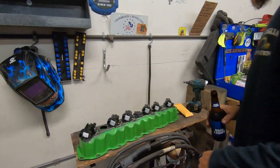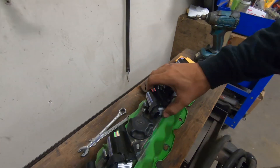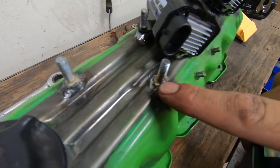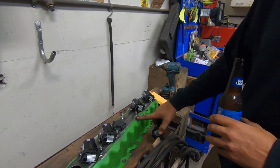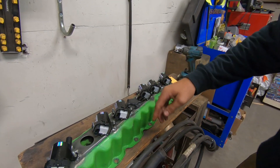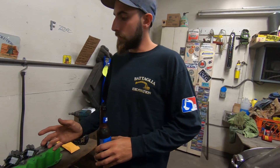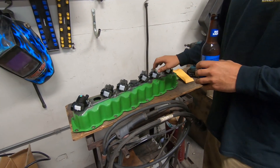While Jeff's working on the wiring, I decided we need to mount some coil packs. What I did was go to the trusty dusty hardware store, got myself a couple of bolts, and welded them right to the valve cover — because to me that's the quickest solution for now. We could get fancy and make a bracket off the valve cover bolts like somebody recommended, but for right now this is the quickest and easiest.